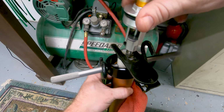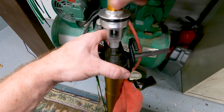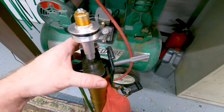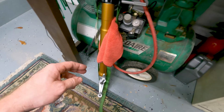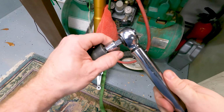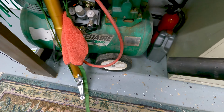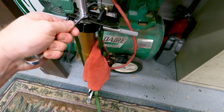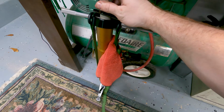It just simply screws on, nothing really to that. Try to keep that nut from moving there. And it's going to be torqued down to 15 Newton meters. Okay, so I'm going to go ahead and set my wrench up for that, which is a little bit tricky here. I can't torque it directly, so I'll have to torque it from the top with my torque wrench. And then I'll just use the 14 millimeter wrench to hold this in place, like that. So just like that. So that's torqued down now.